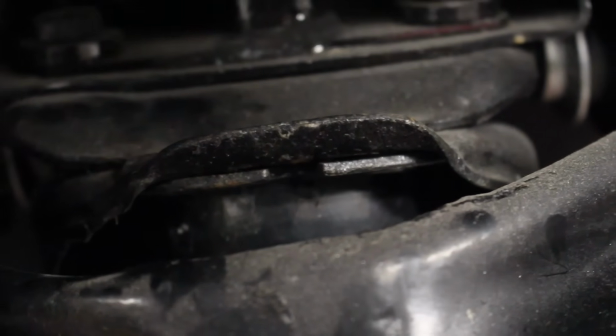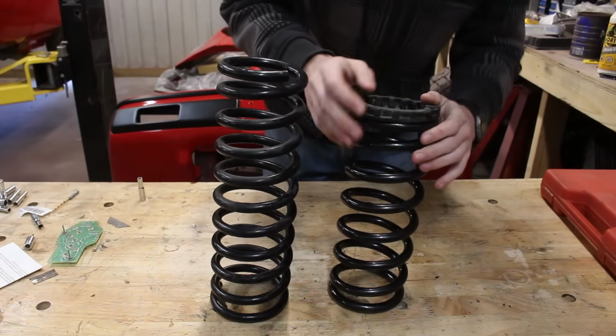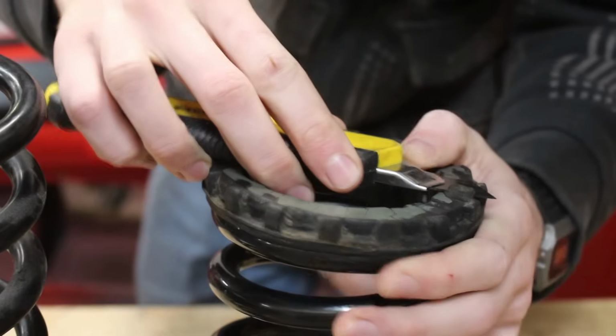Make sense? No? With the coil of the new one ending in a different position, the bottom of the spring wouldn't line up at all if the top of the spring is inserted how the alignment mark currently is. So the solution? Just cut the little nub off, you ding-dong.